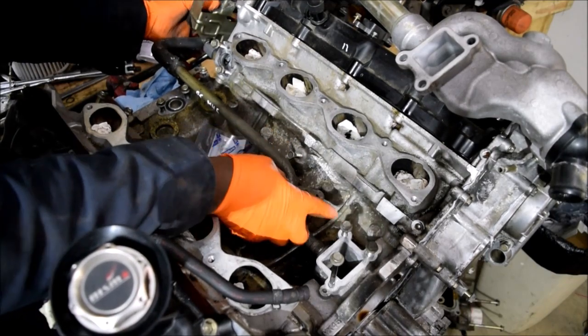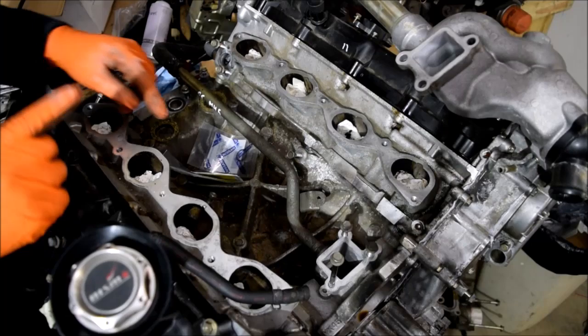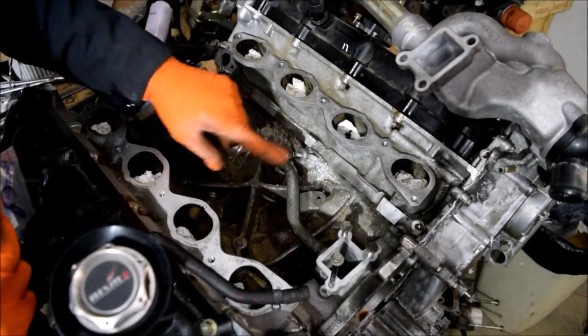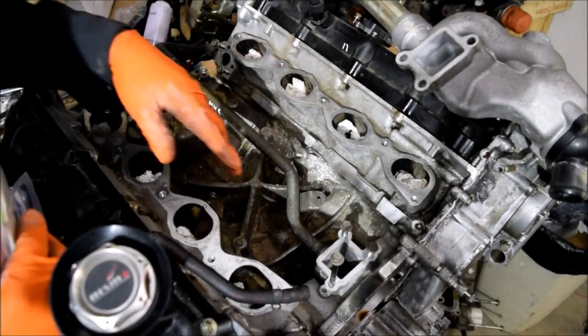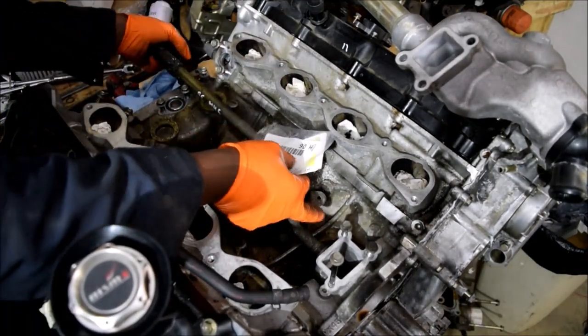There's a missing o-ring, that's why it has that much play. So before all that, something else that's missing in here — knock sensors. I'd like to install those before putting this one down because I'll just have better clearance that way. Let's do the knock sensors first.